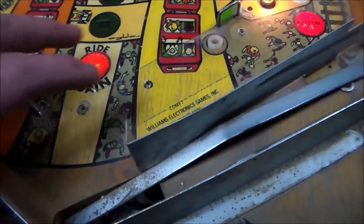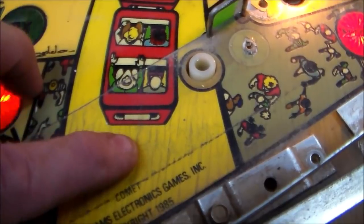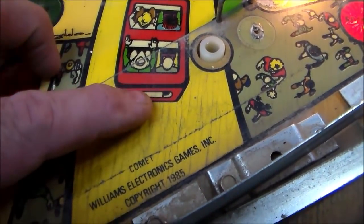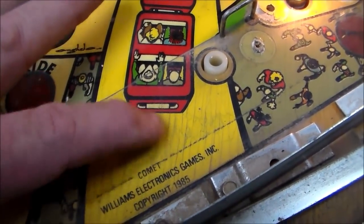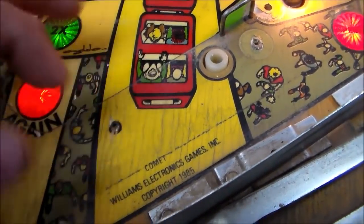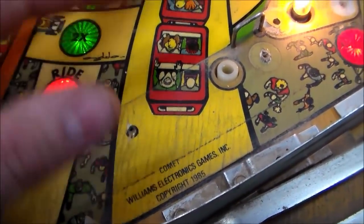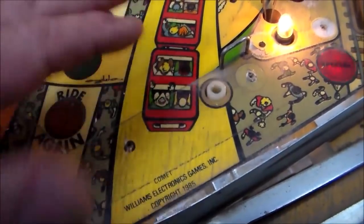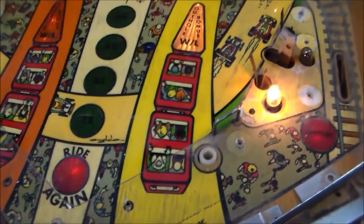The reason that works is because what you're looking at here are little tiny cracks in the paint, and they're real fine. So whenever you clean them with most things, you can't get down inside the crack. But a magic eraser is actually made of smaller particles, so it gets down inside the crack. So it's like minor sandpaper, basically. A magic eraser is basically sandpaper, but it's really fine.